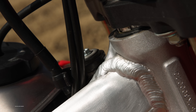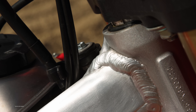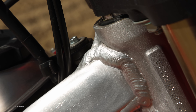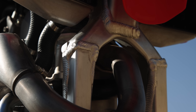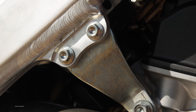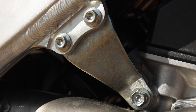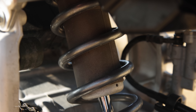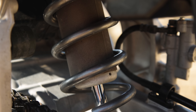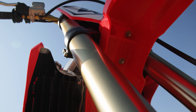Talking about the chassis, Honda's goal was to optimize the frame's rigidity. They increased material thickness at the front joint of the frame next to the bottom of the radiators at the T-joint, and also increased material at the top shock mount. Engine mounts were changed from aluminum to steel to get a little more flex, and they have a slightly different shape. The shock has a stiffer spring rate — going from 5.4 to 5.6 — which is a huge plus that we've been asking for. It also has revised fork settings to complement the new chassis updates.